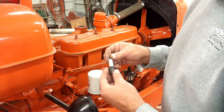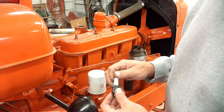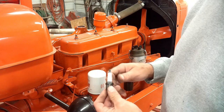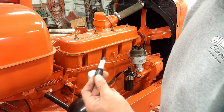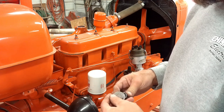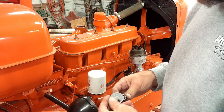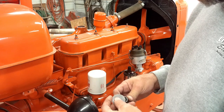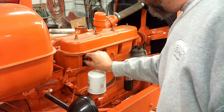I went with the Autolite number 85 spark plug — that's what was in it. I asked on one of the online forums and everybody recommended an ACDelco one, but everybody said they're getting very hard to find. When I went to the parts store they had these on hand, so that's what I bought. I got them all gapped. They say with this electronic ignition you can open your gap up a little more. They come out of the box at roughly 25 thousandths gap; I got them opened up to 35. We'll try that and see what happens.